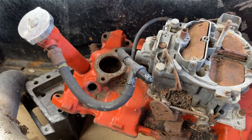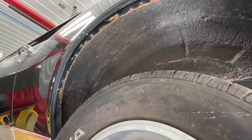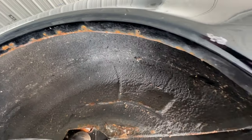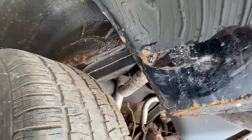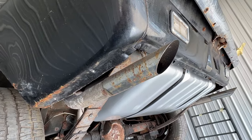It's definitely in need of restoration. There's some rust in the quarter panels in the back, and I'm thinking that rust started from the trim holes on the RS trim package, which had wheel well opening moldings — and a lot of times those screw holes caused rust.